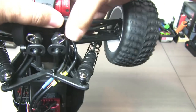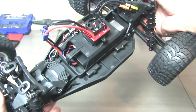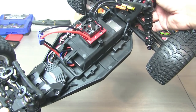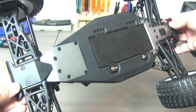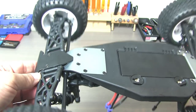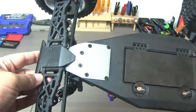The chassis is pretty conventional design-wise — it's an arrowhead shape, as you've seen on stadium trucks before. The defining feature is the battery tray, which is basically upside down to facilitate that trapdoor battery access. You have aluminum front and rear suspension clips. Notably, the arm mount mounts to the underside of the aluminum nose plate instead of on top of it, which is how the original .22 was designed as well.